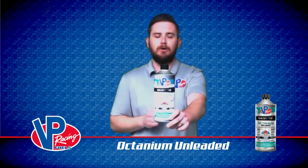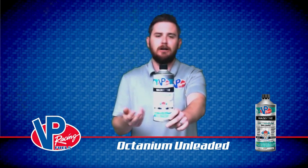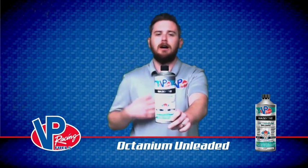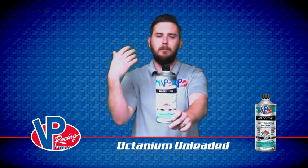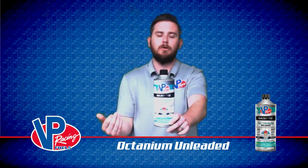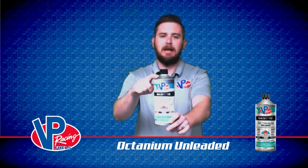A lot of guys will put this in a 5-gallon utility jug. I wouldn't recommend it with pump gas. You can do that with race fuel. A lot of guys will mix this with gas in a gas can. My disclaimer there would be don't leave it for a long time in storage in a plastic container. This is best in its metal can.